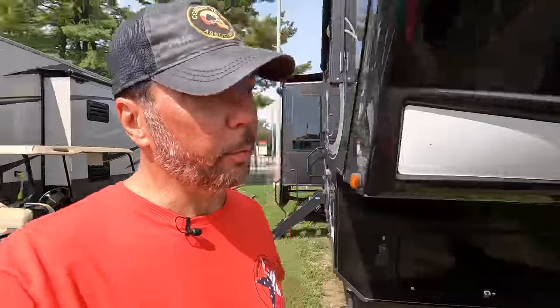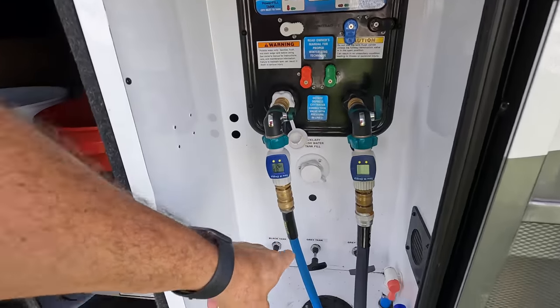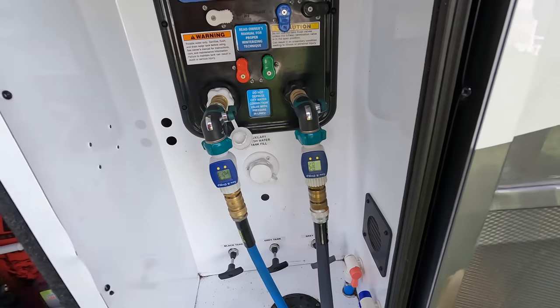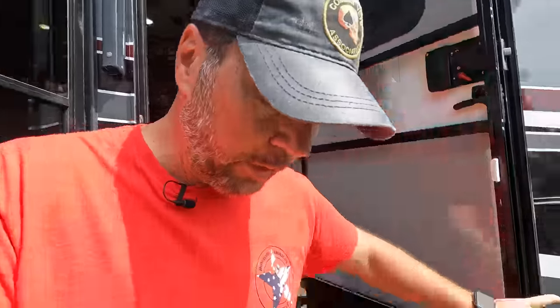Just had to go film a segment somewhere else, so I had to take a break, but we're back and we're gonna finish this flush job. Got an hour till they get here. Black tank close, set my meter there, set a timer for 10 minutes. Ooh, I hear bubbling. I hear bubbling in the toilet. I might've gotten more water than I planned on.